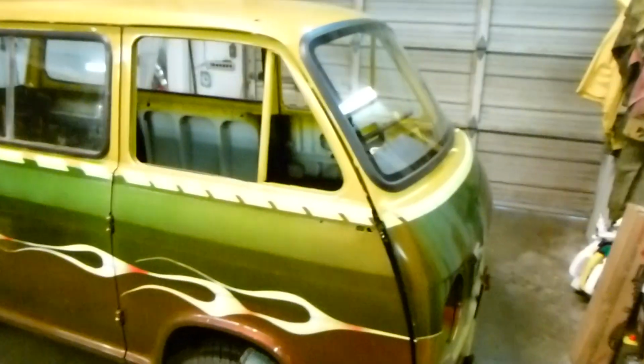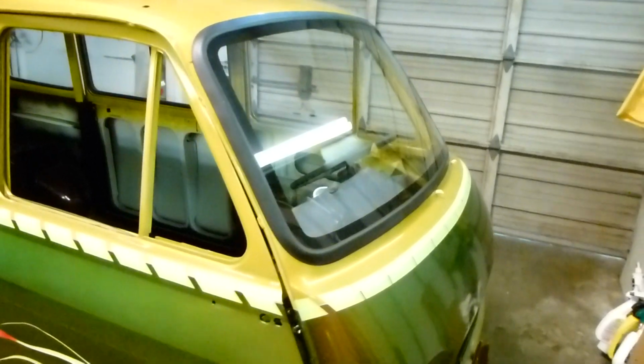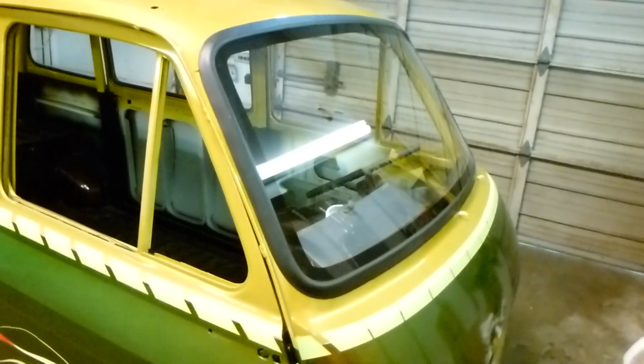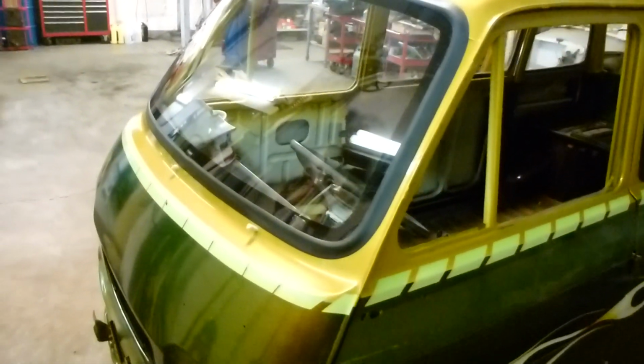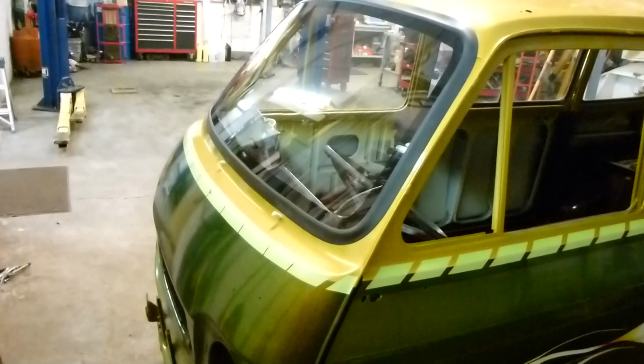And if you're an extra sharpshooter, you'll notice there's a windshield in the van, and a custom-made windshield seal. The one that the Subaru 360 Club sells would not fit this van. Not that it wouldn't fit other vans, it won't fit this van, because this van was rolled and I did the body work and we couldn't get it to fit just right. So we used what's called a lace seal and glued the windshield in. I'll show you from the inside, you can tell.